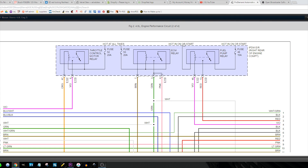This wire here is the control side and it is hot in the on or run position, hot in on or start. So we should have power right here at the output when the fuel pump is commanded on, and we can do that with the Autel Maxisys scanner — we can command that fuel pump relay to turn on. We'll hook up our test light, turn that relay on, and see if we have power. This should prove that the relay is good and everything in this section is working properly. We'll still have to prove out the red wire going all the way to the fuel pump itself. If we prove that we have power here, that means the computer is in control of the fuel pump relay and that circuit is fine.